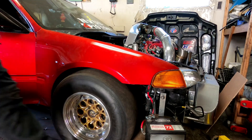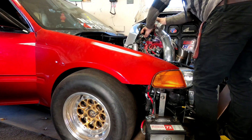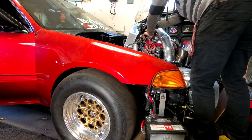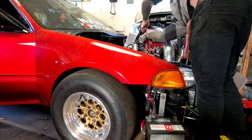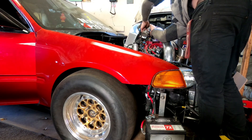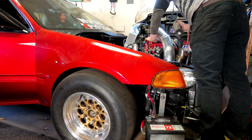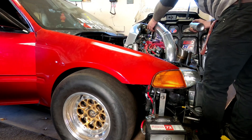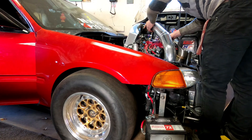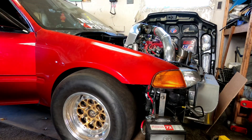We're going to respray it here so we can do this in real time. Give it a shake. I'm just going to open the throttle body up — spray a little bit in here, get the valves all done up. Not too worried about inside the intake. I'm going to take this all apart in a couple of weeks anyway. It's as simple as that. I'm going to turn it over again and that'll be good. I'll set the plugs back in it just so nothing gets in it — no condensation.